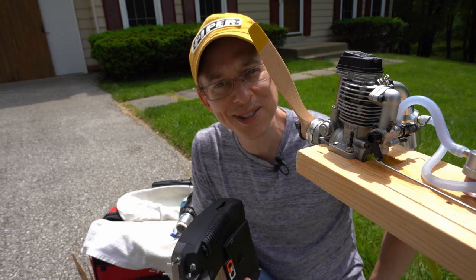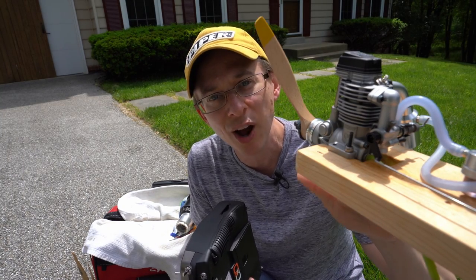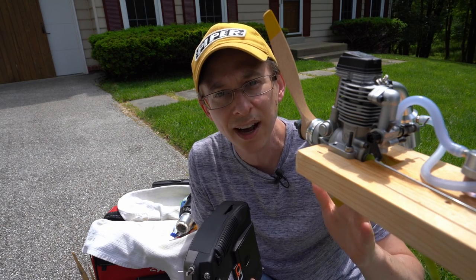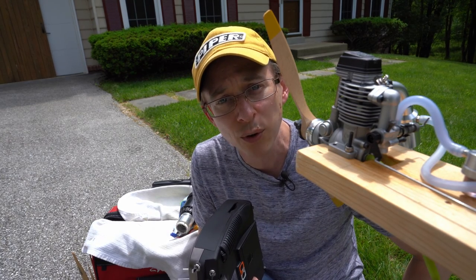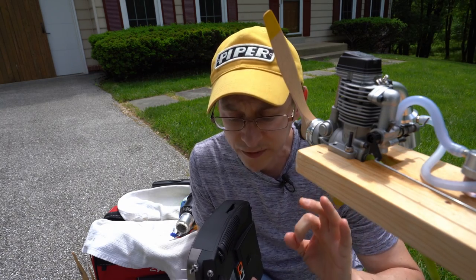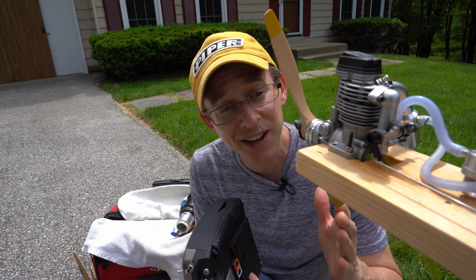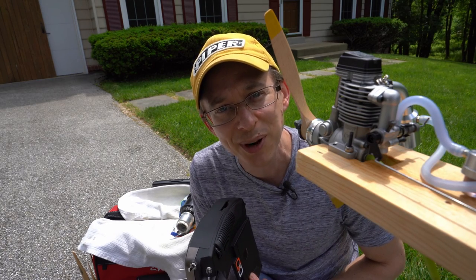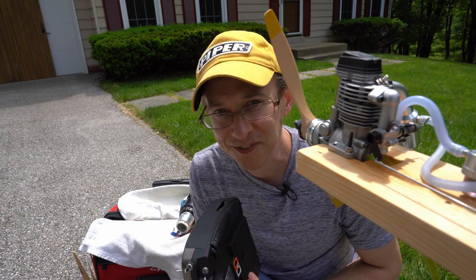There you have it — a little run-in, run-up, break-in process. I'm really excited at how the test stand worked out and how quickly and easily this engine turned over. I'm going to put a couple more tanks of fuel through it to get a really good break-in. The smoke coming out is really white and that's perfect; eventually I'll thin it out and get it tuned up to exactly where I want it. If you're interested in getting into engines, I hope you don't feel intimidated — once you start understanding the parts and pieces, you'll be well on your way. Thanks for watching, fly safe, fly smart.